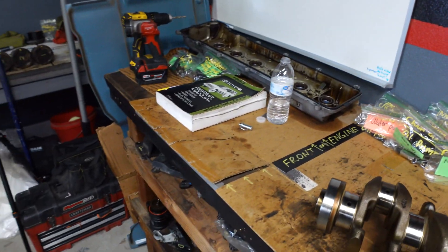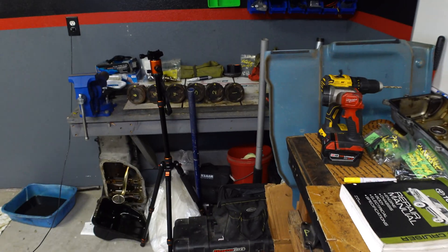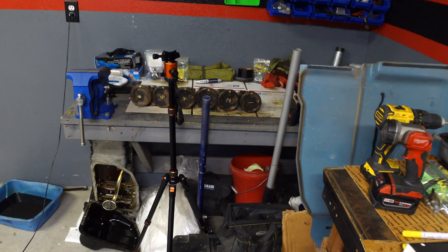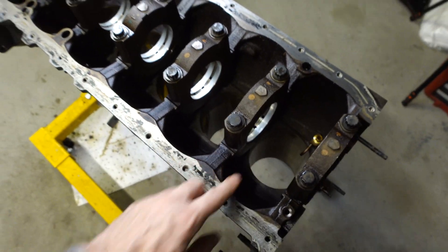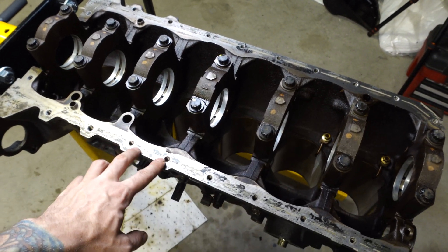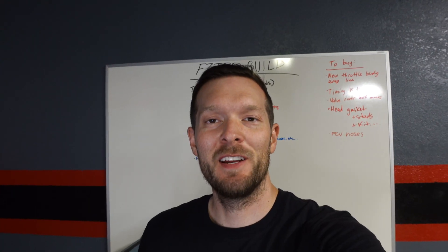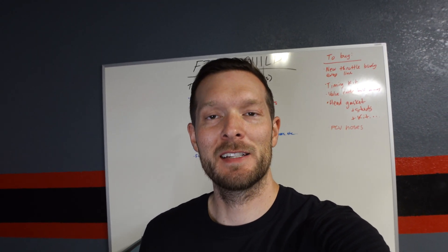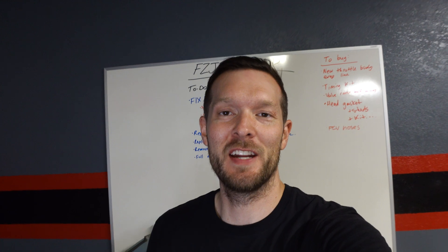As you can see, the cylinder head that was right here is already gone, as well as all the valve train. I dropped those off at the machine shop today and then I'll be dropping off the block next week to get the cylinders honed, a hot tank, and the deck resurfaced as well. That's going to wrap up today's video. Thank you for following along throughout this bottom end tear down. If you're interested in seeing more Land Cruiser content, especially rebuilding this motor, make sure you subscribe to the channel so you don't miss when I post new videos.